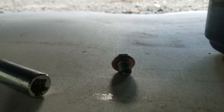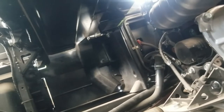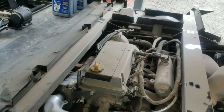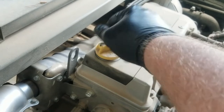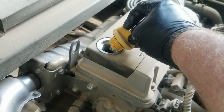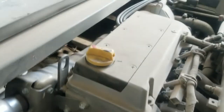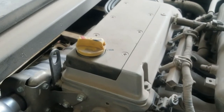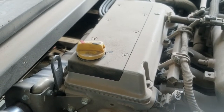I'm just about ready to put that drain plug back in, then we'll get started on the filter — the filter's going to be a little difficult to get to. I forgot to mention: I like to open up the oil fill cap before I unscrew the drain plug. It just helps it vent and pushes that oil out in a quick steady stream instead of dripping forever. Just something to consider.